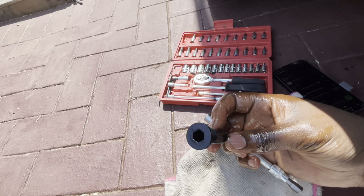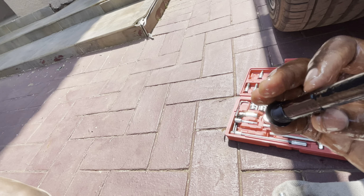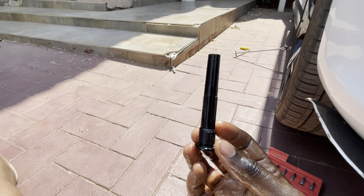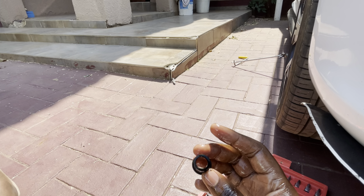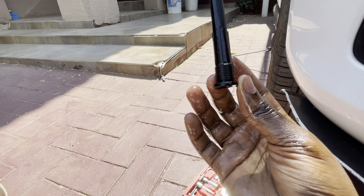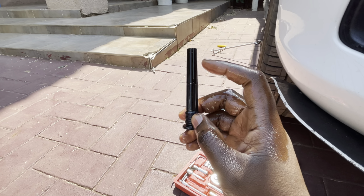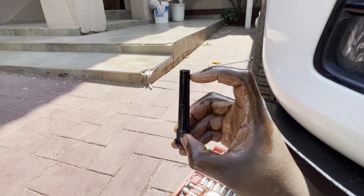And I highly doubt this part can actually get damaged, but there's a pot that sits inside and screws on, and I believe there's the one that holds the level to the right size. Okay, so this makes sense now. So this goes inside, right? When you fill, the oil goes over the top piece, right? Still at the same level. Okay, now I believe what probably happens inside there is the oil that first comes out is overspill that goes over from here and just gets caught at the bottom, and then when you fill it up, that oil goes over, it goes into here and fills the reservoir where all that oil sits, which will probably be sitting roughly that high. So it makes sense.